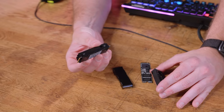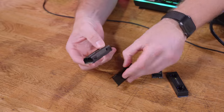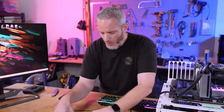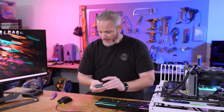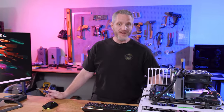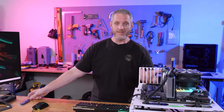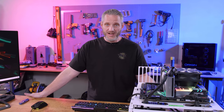This attaches in the exact same manner — they're even the same bottom piece. The heat sink design is more efficient at radiating heat away rather than a flat piece of metal. For our testing methodology: there's not a lot of software out there designed for long-term SSD stress testing. We've got CrystalDiskMark, which allows up to a 64 gigabyte file size. With straight sequential read/write at over 6,000 megabytes per second, how long does 64 gigabytes take? About 10 seconds. So we're running the test nine times.